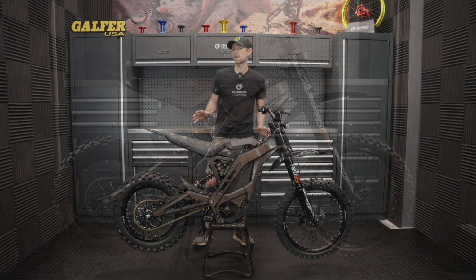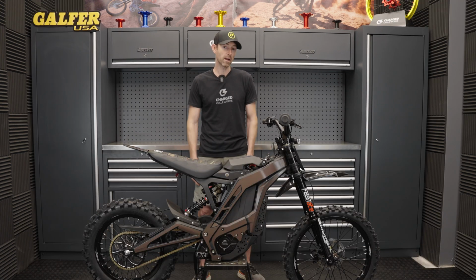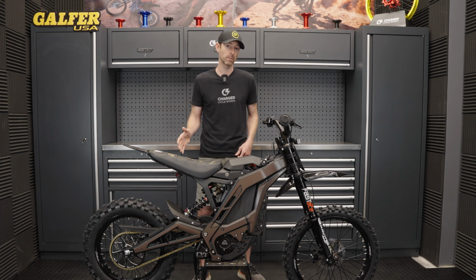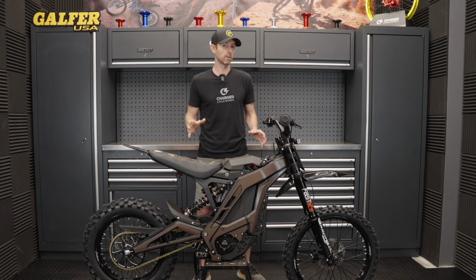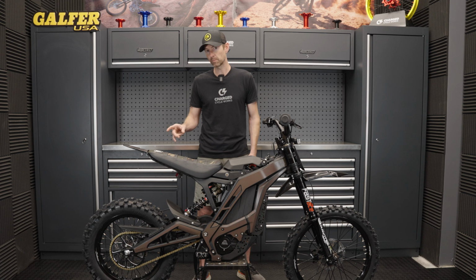Part of the reason we like 16/19 is they're very widely used in the motorcycle market. So on a lot of the mini moto bikes, the tire manufacturers have just put in so many decades of development that we get to choose between perfecting the size and the compound and the tread pattern that we want. We're just lucky that we get to benefit from that on a bike like an E-Ride Pro. Without having to trim knobs, it just fits right on the bike and works perfectly.